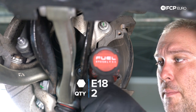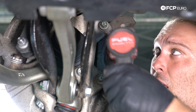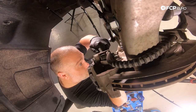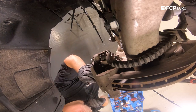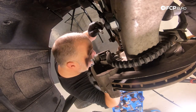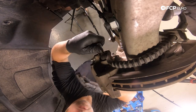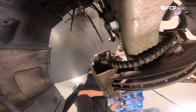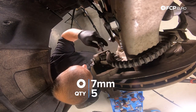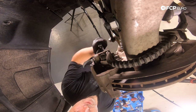The caliper carrier bolts are E18 — I'll use the gun to seat them and then torque to 110 newton meters. Reinstalling the guide pins: all I did was clean them up with a Scotch-Brite pad, removed any surface contamination, and I'm reinstalling them dry. I used to lubricate these as well, but I don't anymore — lubricants can attract dirt, which will cause the caliper to stop sliding back and forth. Just make sure they're clean and the boot is in good condition. I also went ahead and re-lubricated the pads, cleaned the carrier, and all that good stuff.